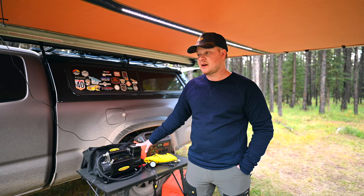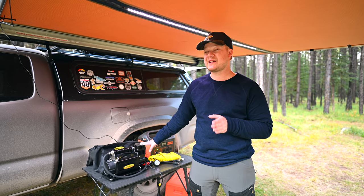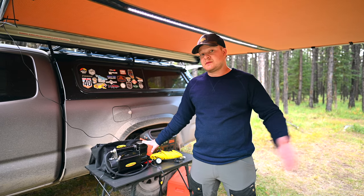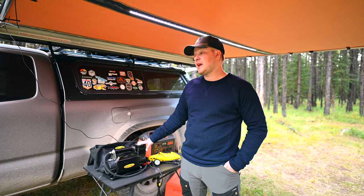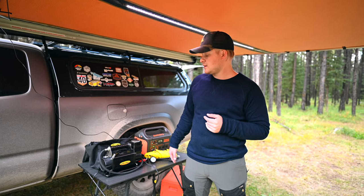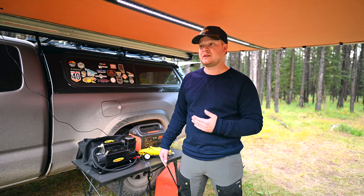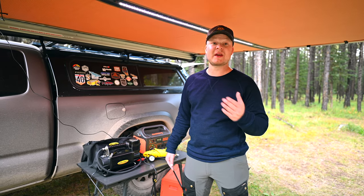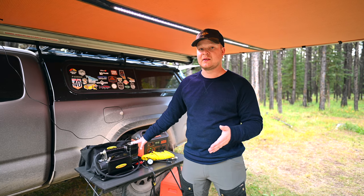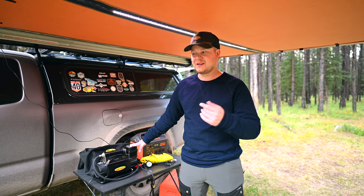Another positive is the actual time it takes to air up a tire. In my experience, going from 20 PSI to 32 PSI on a 31-inch tire, you're looking at about 90 seconds — really quick in my mind. You're looking at maybe 8 to 10 minutes tops to air up all four tires. If you want quicker, fork out more money, but my advice is to be patient. There's no sense paying four times the cost for a compressor that saves you maybe two minutes.